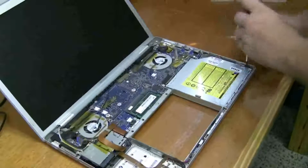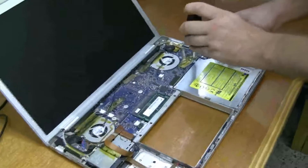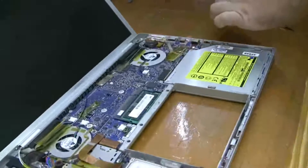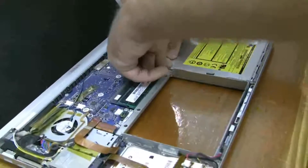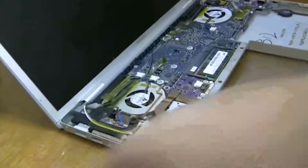It's really going to make your life easy. This is what the Torx 6 looks like. Just kind of pry up gently on this Molex connector for the DVD drive, and then you can lift it right up. It's an easily replaceable unit.